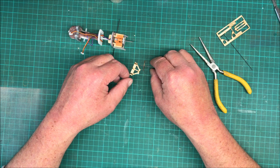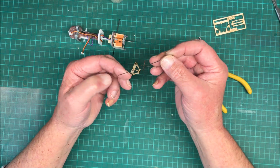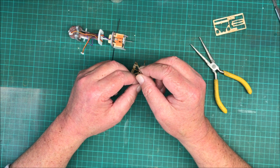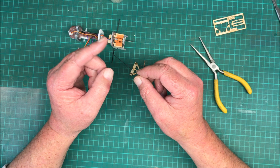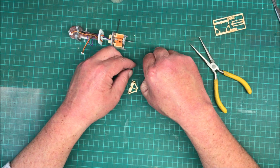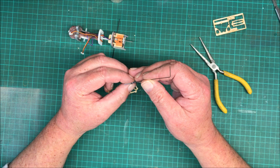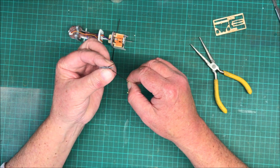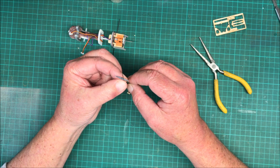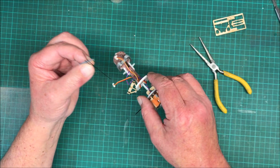Now the next bit is the wire bending, and you'll find in your pack a piece of wire. It's already got a bend in it, and there's a 2mm bend, a 3mm bend, and a 7.5mm bend. I'm not sure why there's a bend in that, but you have to make two pieces, which will go something like, if we can pick this up again, through that hole there. Then that has a crank on it, and then that will do that basically. That's what it's designed to do. And then this goes into the servo arm like that.